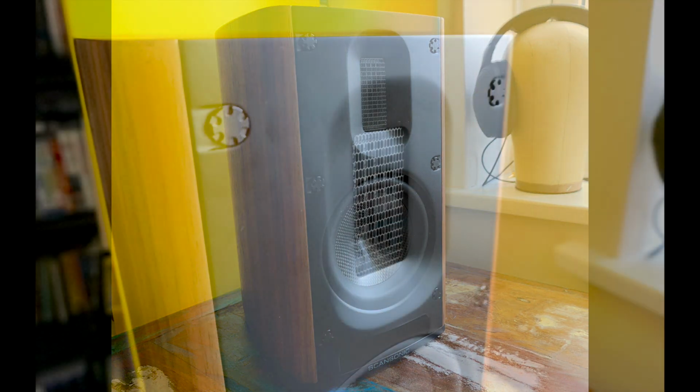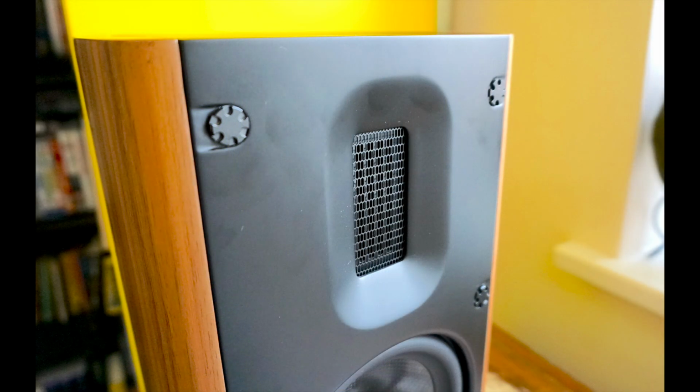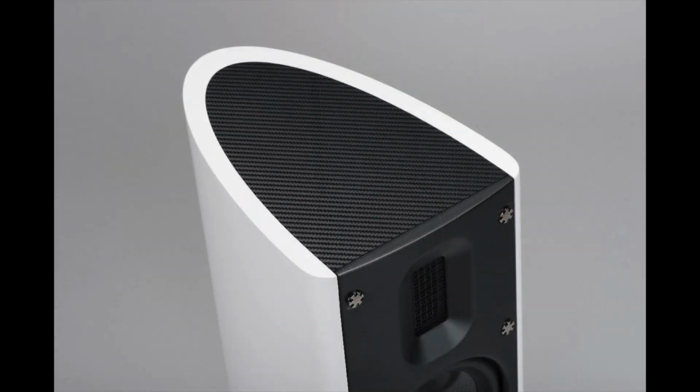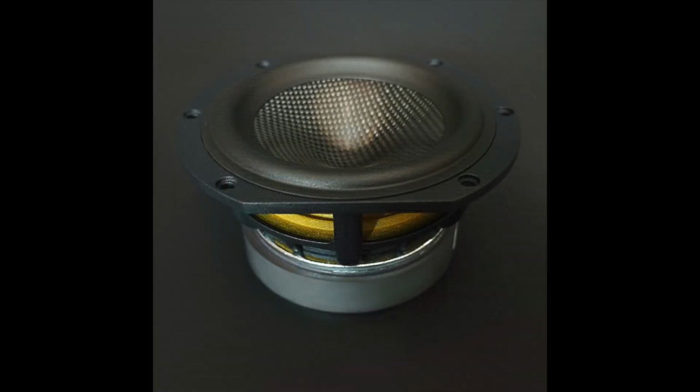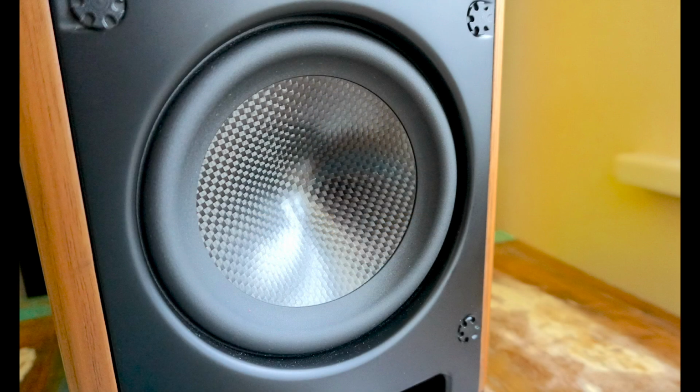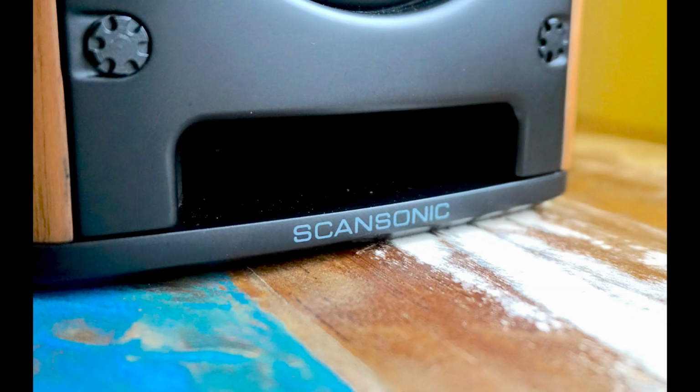And it is, with the membrane formed by a Kapton aluminium sandwich of 20 microns thick. But as you are well aware, a star can carry a show, but certainly isn't the show. You need more than a planar tweeter to create a great speaker. So look out for the 133mm carbon fibre weaved mid-bass driver, sans dust cap, as you can see here, that sits below, and the quite heavily braced and rather curvy ventilated cabinet with a front-loaded port.